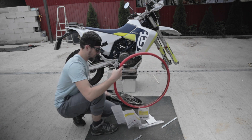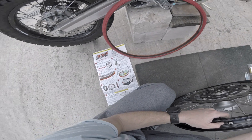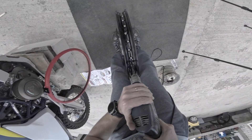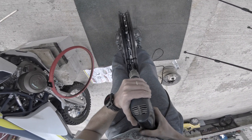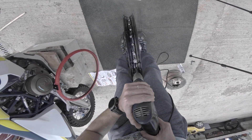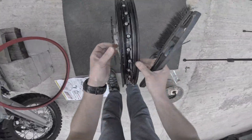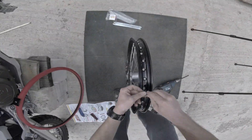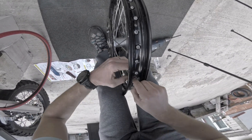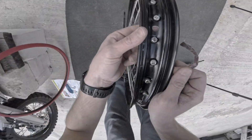You will notice that you have already two holes in the rim placed at four spokes apart. One of the holes will be covered by a rubber plug. You will need to remove that and choose one of the holes to enlarge it using an 11 millimeter drill bit. After that you need to use some sandpaper on the hole you've drilled previously — don't get any weird ideas. You need to do that in order to remove any sharp edges that will wear your tire chamber valve.